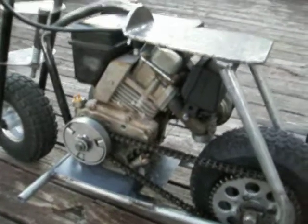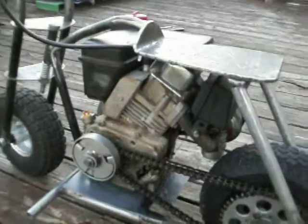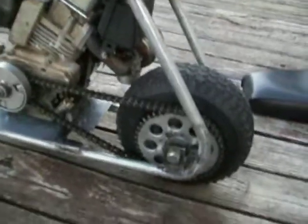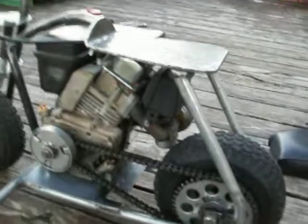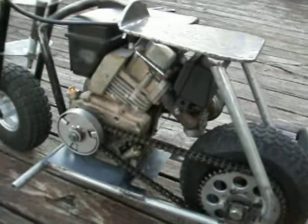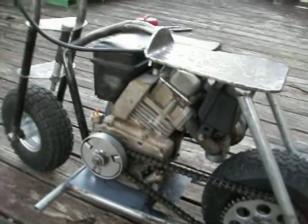I told him as soon as you find out that you can't afford to replace all that stuff, that you can buy a new one for what it costs you, just holler at me and I'll come up and get that sprocket. A sprocket half that size would reduce the takeoff power and make less likelihood of you getting jerked off of it or thrown off of it. Give you about 15 to 20 more mile an hour top end.